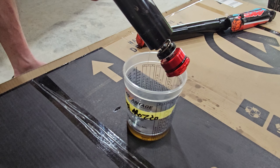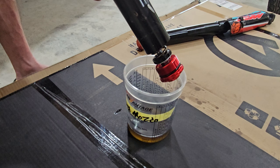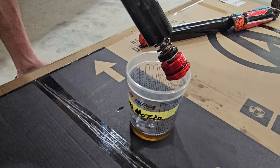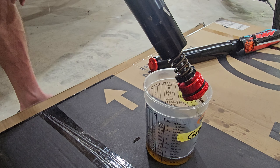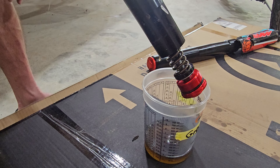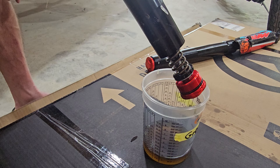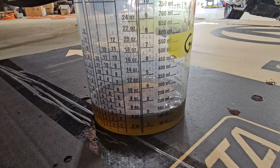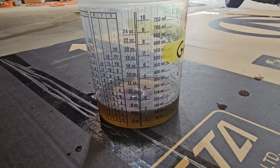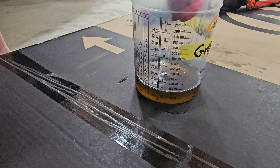Very excited about being able to modify it and get it to feel better for my weight, like I was able to do with the rear shock. I'm not sure what weight oil comes in the factory forks, but I'm going to end up going with the 20-weight fork oil - I'll have a link to that in the description. It looks like this one's at about 125 milliliters. We'll see what the other one is and split the difference. This one's also at about 125 milliliters, or just a little bit over four ounces.